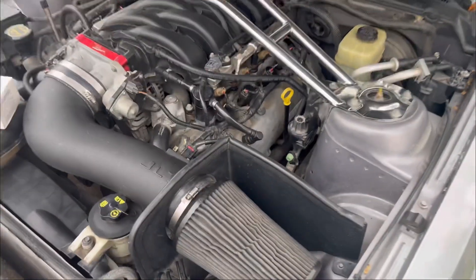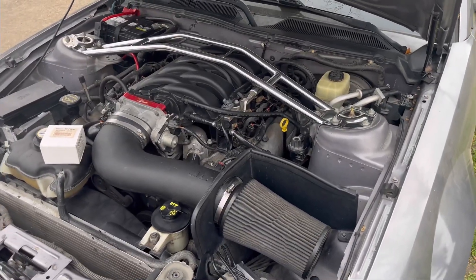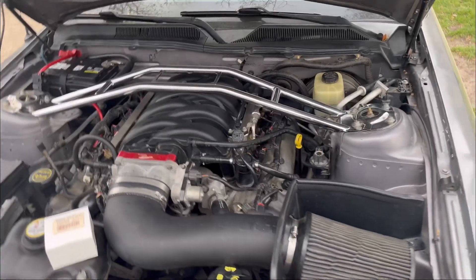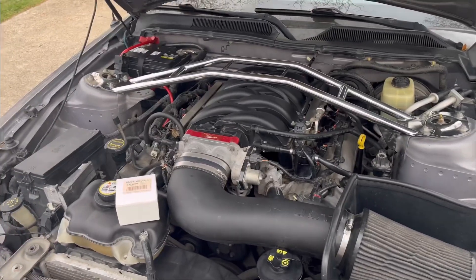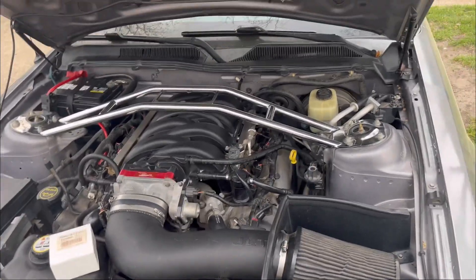This car has a lot of miles and a lot of upgrades, and I'm hoping that there's not some kind of deeper issue. I do also keep getting the upper O2 sensor codes — stuck lean — and it's making the car run rich, and I've replaced them and the code keeps coming back.